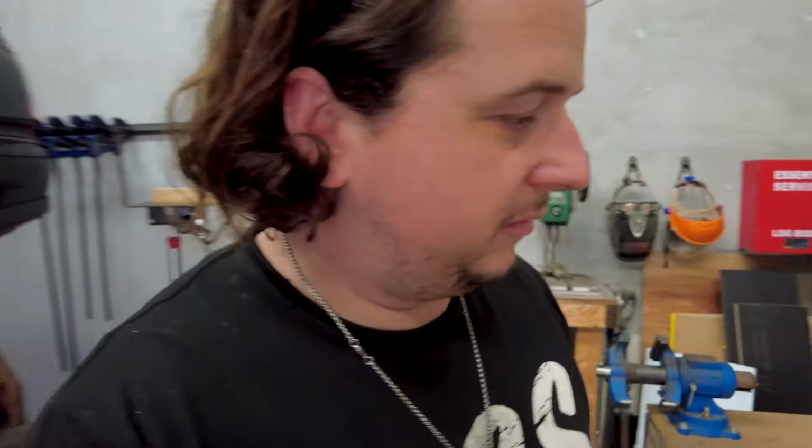You definitely set me up with that bolt though. It was hard to film, so I don't know if I got much of it, but I had to tap the bolt hole out and put a new bolt in there. So whether he did that or whoever, I reckon whoever installed the sway bar must have stuffed it up, and maybe they thought it was tight because it cross threaded, so they probably thought the bolt was in there done up, and then it's ripped out.